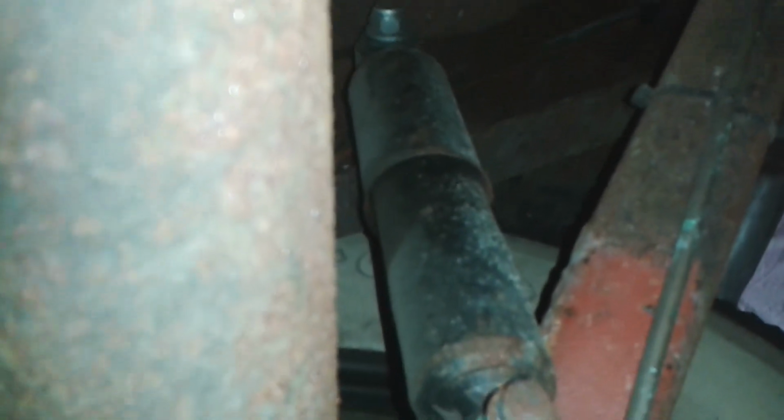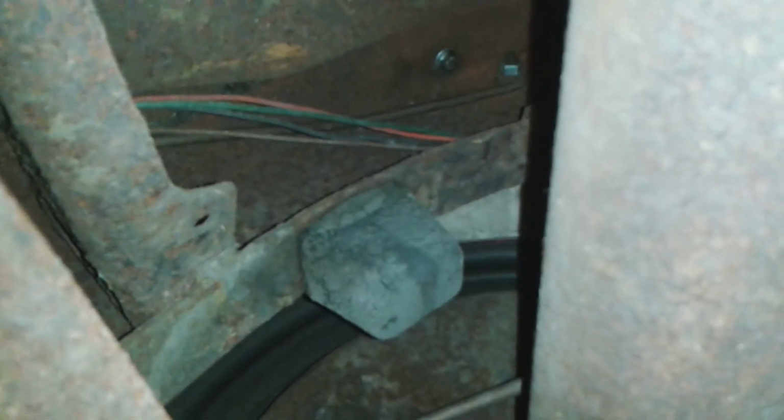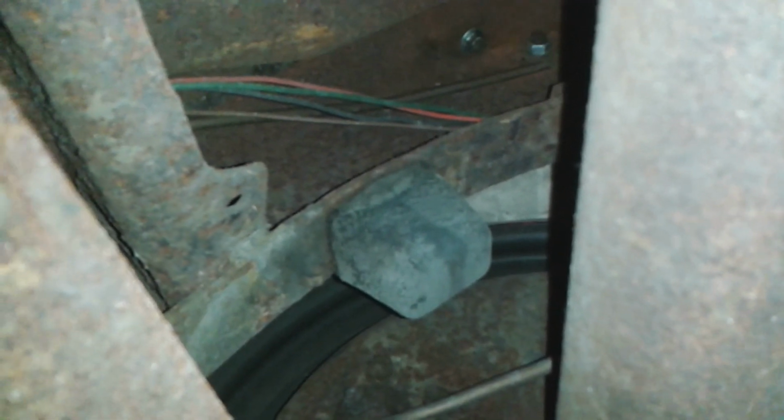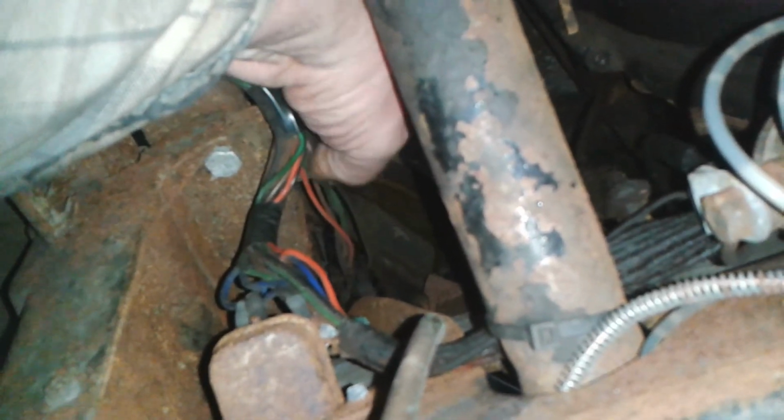So we've just got 4 wires, haven't I, running back? 4 wires. Two brake light filaments, rear lights, and the tank sender. And the black is the tank sender. So there's my wires coming from the back of the car. And there's another wire there now. So there's more than one black wire. Okay. So they go up there, across there, and I think they'd come up and in here.